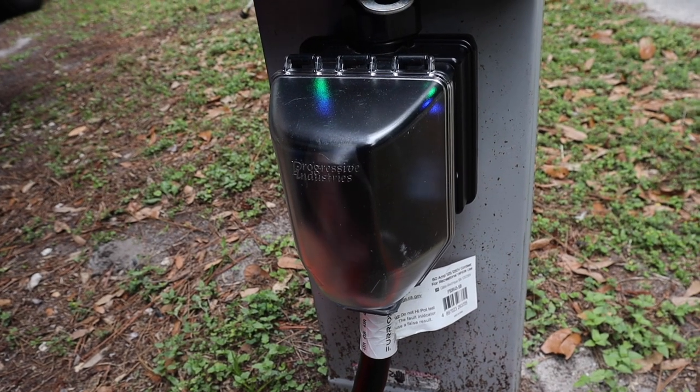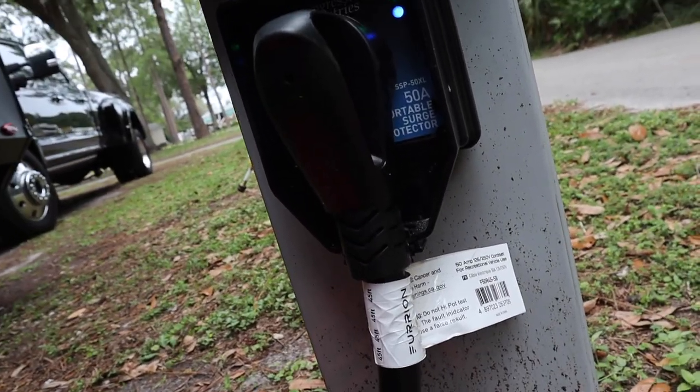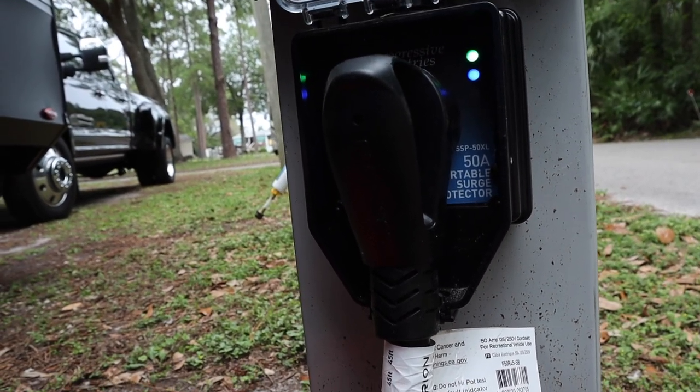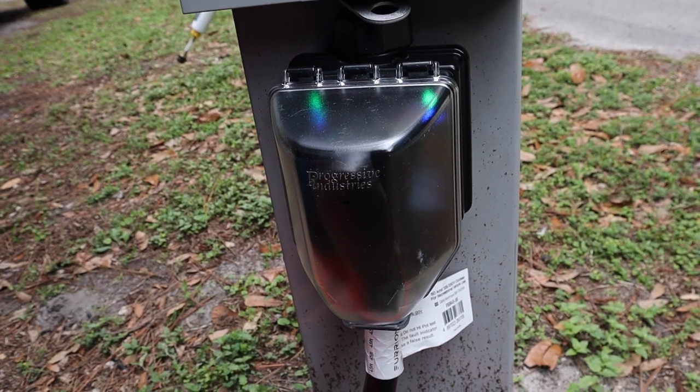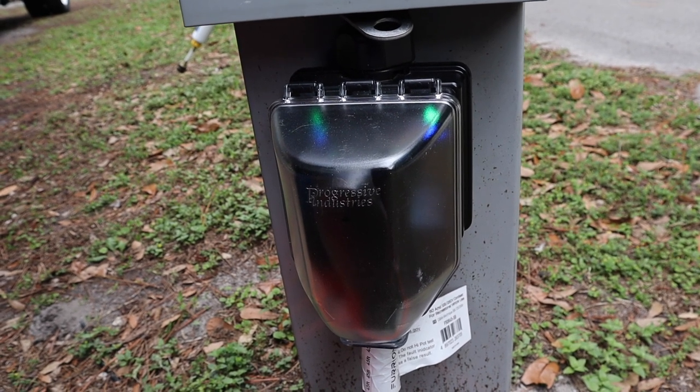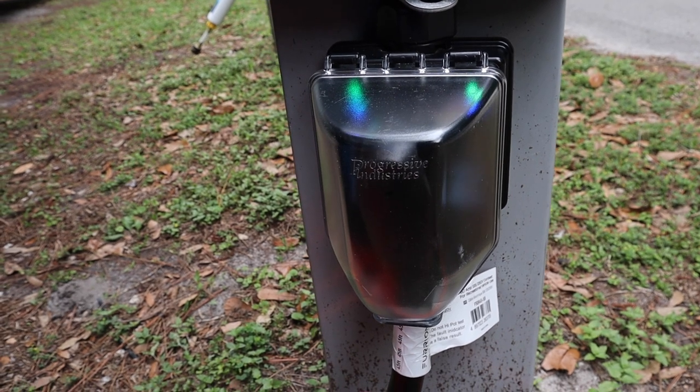As far as your power connection, your unit should have come with a power cord — a 30 amp or 50 amp connection. One of the most important things you need, whether you're part-time, weekender, or full-timer, is a surge protector at the very minimum. A lot of RV parks have unstable power, and thunderstorms can cause electrical surges. If you don't have one and something comes through that power cord, you've got a big, expensive problem. This is the surge protector I use, made by Progressive Industries. It has LED lights — green and blue — indicating both sides of the 50 amp power are good. I plug it in before connecting it to my rig to test the power. Green and blue light means I'm good to go. Any other color, there's a problem — we'll get into that in another episode.